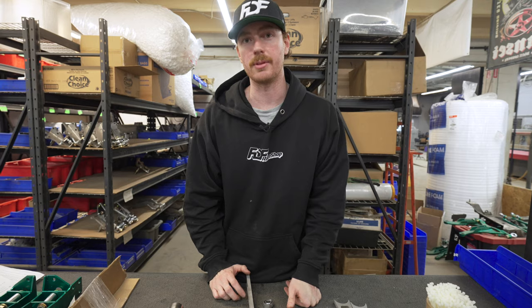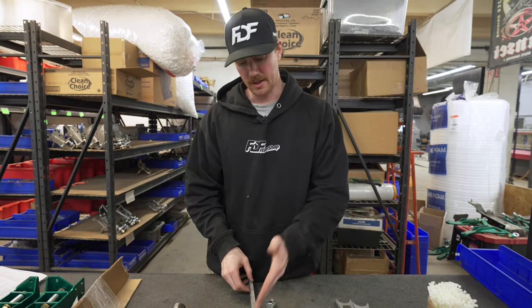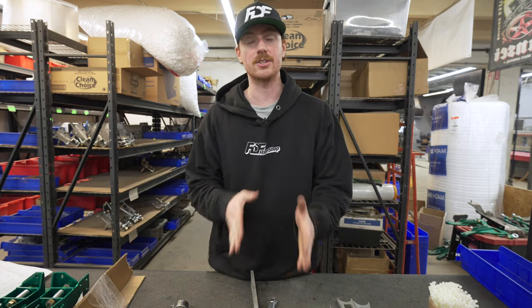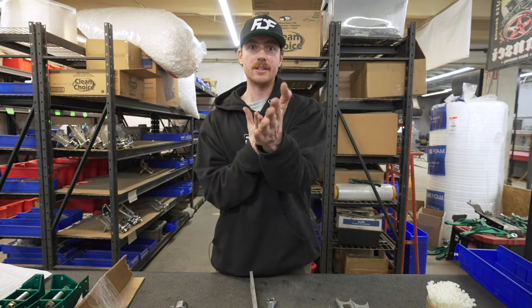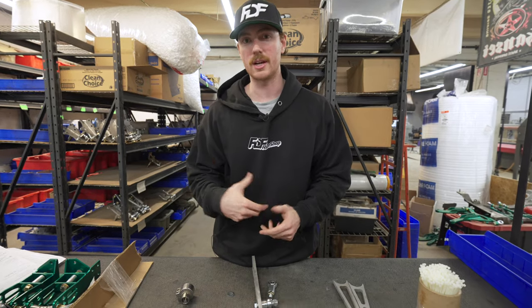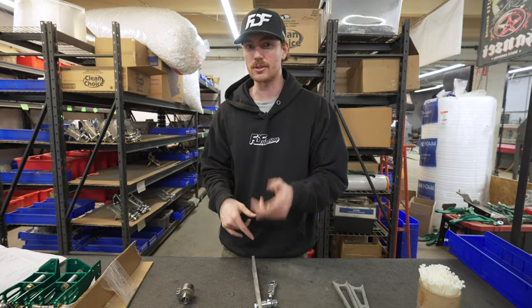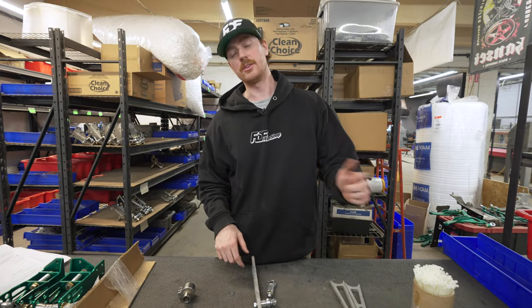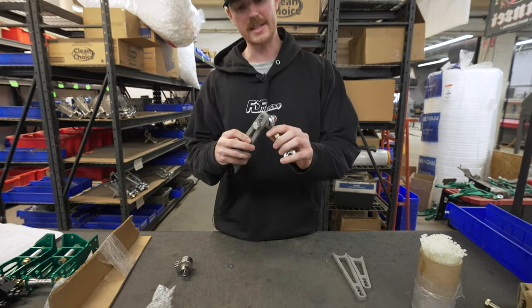This would be a really common thing to do in the rear for your fine adjustments. I have personally done this many times and you'd be surprised at how much it actually allows that blade to twist. Normal sway bars are made out of spring steel, so you can do this with stock sway bars as well. You'll find that it does soften it quite a bit. You can do this in the front as well — so that's a little tip for you.